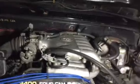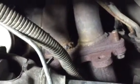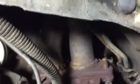The last and final hurdle with the swap is the exhaust. You have the option to either buy it pre-made or make it — I chose to make mine. Originally on 99% of 3.4s, the exhaust drops down on the passenger side, but on a 3.0-equipped vehicle it drops down on the driver's side, so you will have to reroute it.